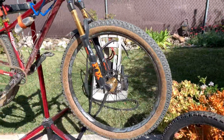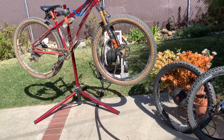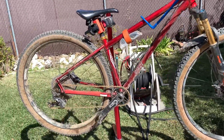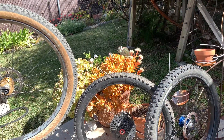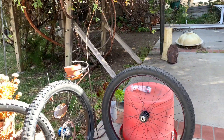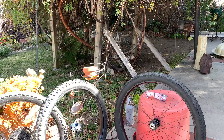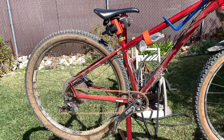So I actually have three bikes in a way by having just that one frame and the extra wheelsets. I kind of like that I can mix and match and try different things out. The 29er setup rolls fast and climbs faster, but the 27.5 plus wheelset just can smash rocks and go down the really loose gnarly trails with no problem. The mullet setup lifts up my front end a little bit, so it makes my bike a little bit slacker and gives it that combination feel of being able to roll over stuff real easy with that big 29 in front, but being able to corner really nice with the smaller 27.5 in back.